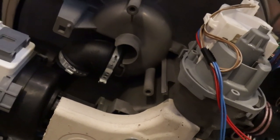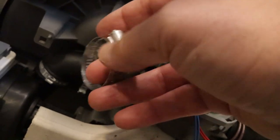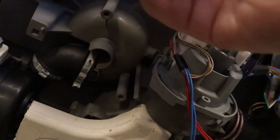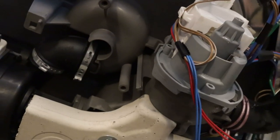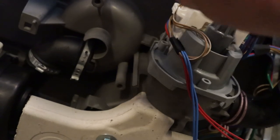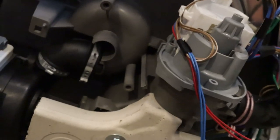The new pump kit supplied me with just a regular hose clamp, because even though I have a crimper tool, I don't think the average homeowner does — so this is a lot easier to put on. And the thing with any hose clamp — it's just like putting a hose clamp on a radiator of a car. They're plastic these days, so if you do these things too tight, you'll break it. So that's what we're going to be careful of.